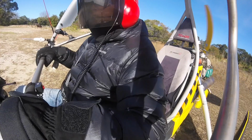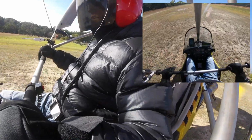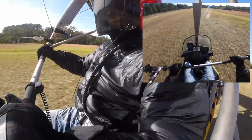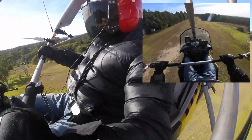For those that don't know, my particular Tanarg has the Outback version. So it's got the wider tyres, and I've got brakes all round. So it's a two-part system. The front brake has its own master cylinder, and the rear brakes have their own master cylinder.